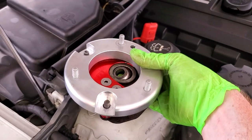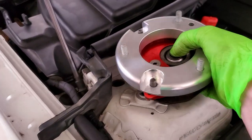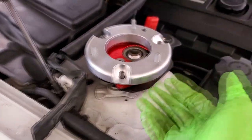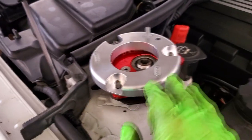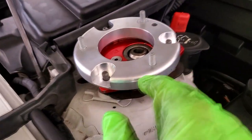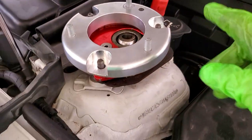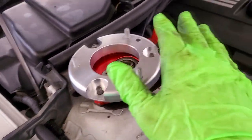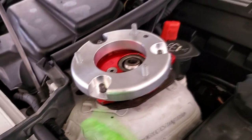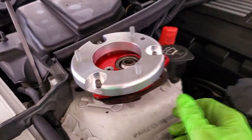There's some precedent for this — it's actually an old BMW trick. In the E36 and E46 communities, a common trick to get additional negative camber out of your stock setup is to swap your top hats left to right, because the OE top hats are designed with a slight bend to accommodate the spring, which gives you more negative camber when you flip-flop them left to right. That's what originally gave me this idea, so I'm hoping this actually works.